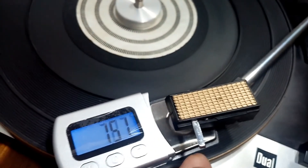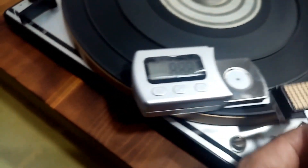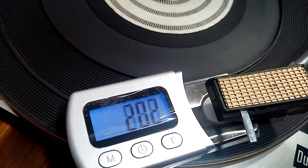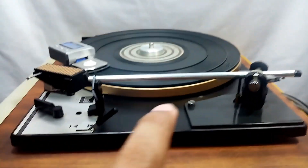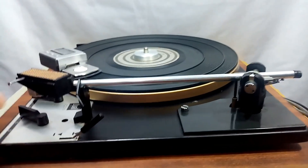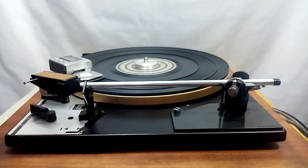So there is a difference of only 0.01. I'm going to try adjusting to 2 grams now — the scale reads 2 grams, with a difference of 0.02. It really works! My tip: make sure you get the proper 180-degree float first. It must be floating and settle back parallel to the platter at 180 degrees. Hope it helps — please subscribe to my channel, thanks for watching.